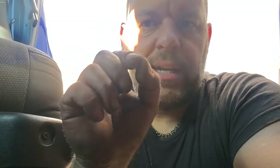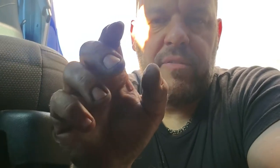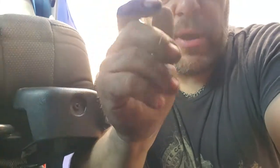You'll pull the first part out — it's probably a dust seal — which comes out easily by wiggling. My advice: because I was wiggling and turning trying to see if anything was threaded, and eventually I tugged and the whole thing came out and got me a little goopy. I'd recommend putting your whole palm around it for more control, wiggling it out gently. As soon as brake fluid starts coming out you're probably good, but mine was so black I bled it through until clean fluid came out. Then push the plunger back in, put the snap ring back in, put it in the hole, come inside to make sure it's aligned through the square hole, give it a quarter turn, and you're off to the races.